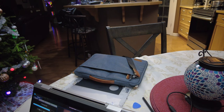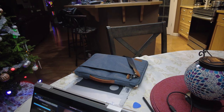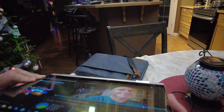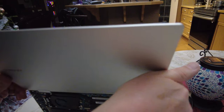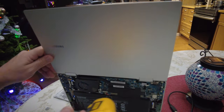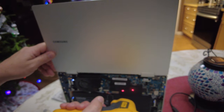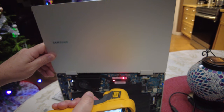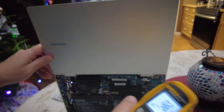and put the high performance mode to see if it's gonna help. Because if I put it in high performance mode, it should work faster, but the most important thing, it's gonna get some cooling because the fan is gonna be on. Now the fan is on, and the processor is 67 now, and it's 49 for the card. See, 69 and 48, so it is cooling.